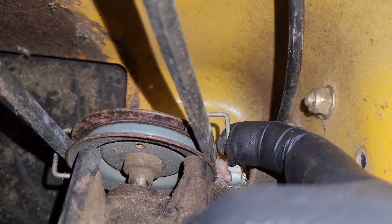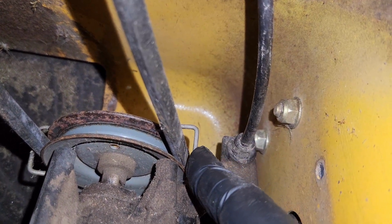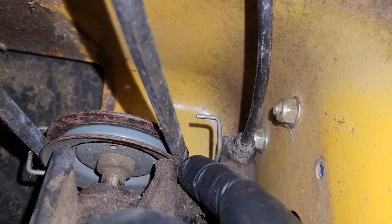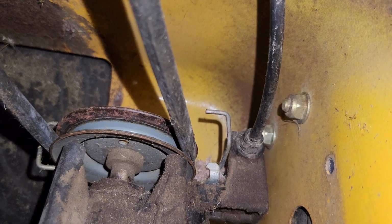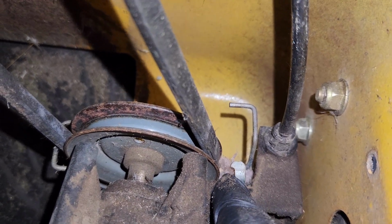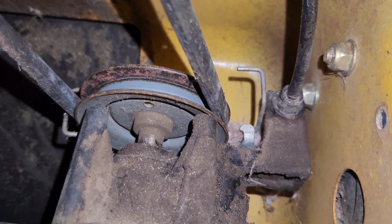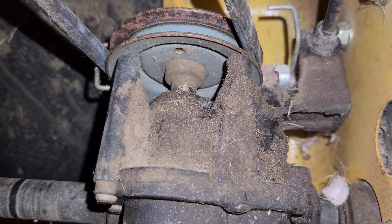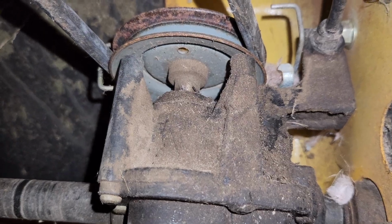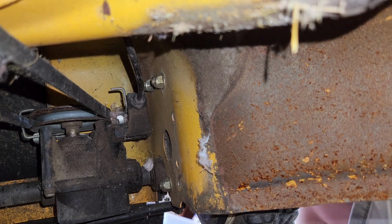Does it just go over the end? It does. Wondering if this is vibrating and just sort of popping back up, and then the guide doesn't do anything anymore. I wonder if we can mutilate this tab a little bit to help with that. Let's do it. I gotta figure out how to position you, because this is just not functional for either of us. There we go. I have you wedged in between the engine and the belt adapter. Let's see what we can do.